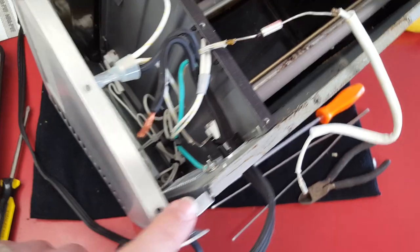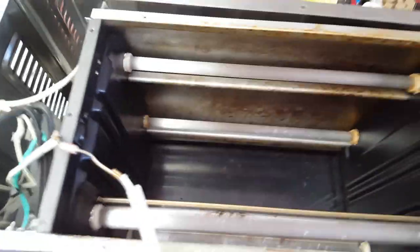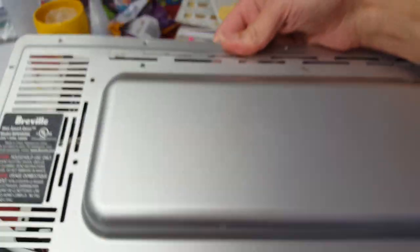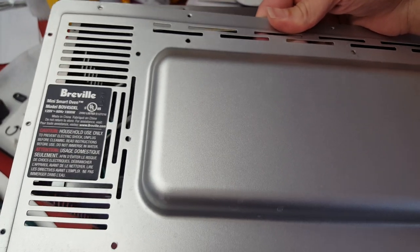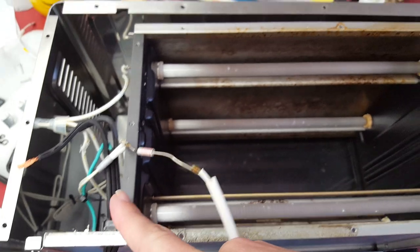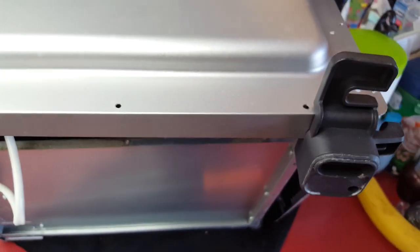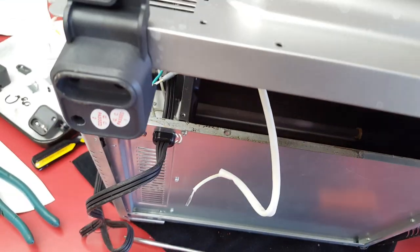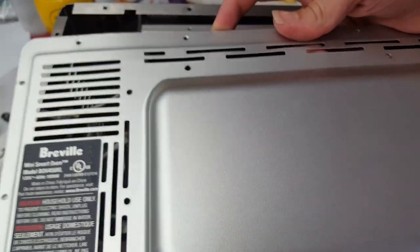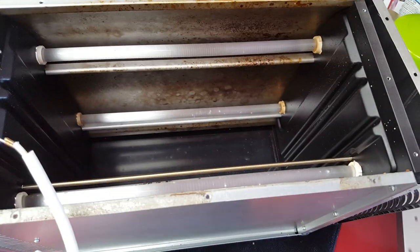Who knew a toaster oven would be this hard to get into? You have to unscrew all the screws around the back of the oven, and there's also an additional set of screws — you can see the back plate has a bunch more screws to the right of the label that go around the center of the assembly and screw into the inner chamber of the oven. The back feet actually don't come off when you take the screws out — all it does is unscrew from the metal housing, and then you have to wiggle it to get it out from underneath the back of the top cover. The top cover is a full piece.